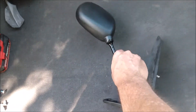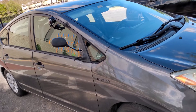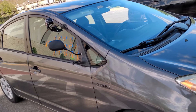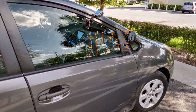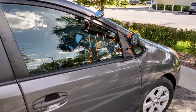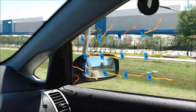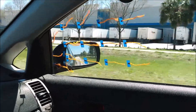Let's do some testing. I decided to do some tuft testing to see how the mirrors affect air flow. This is nothing fancy — just some orange colored yarn attached with blue painter's tape. I drove the car at about 50-55 miles an hour and filmed from two different camera angles: a camera mounted to the outside of the window looking down, and my phone filming from the inside of the car looking out. Speaking of which, here's what the airflow across the window looks like with the stock mirror — it's actually not that bad.